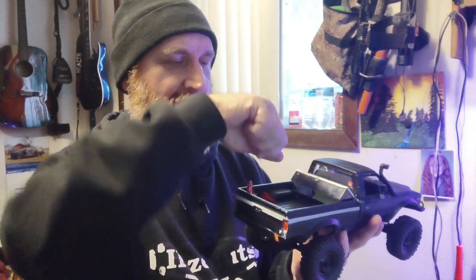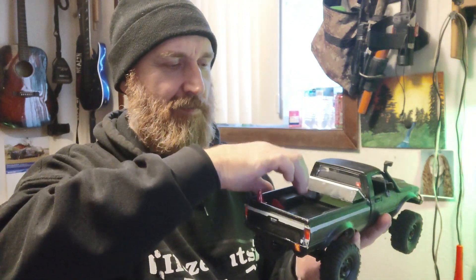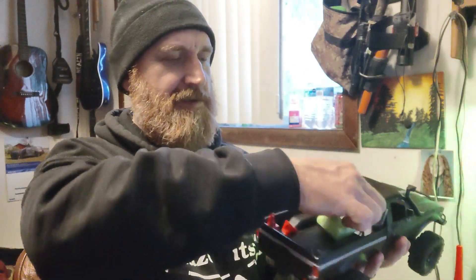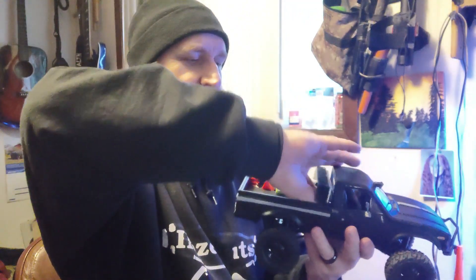Another thing — this thing always popped open down here with the little tabs. I took my needle nose pliers, grabbed the tabs down here, pulled out and twisted a little bit. The tabs on the inside I just pushed down with my finger a bunch of times and now it clicks shut so the battery doesn't come out. There was so much room in there that I also cut a piece of foam block that fits in the tray and holds the battery tight.